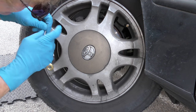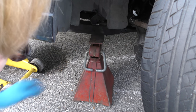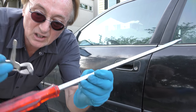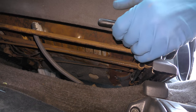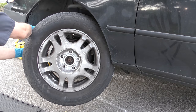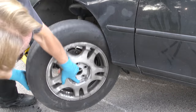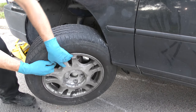I'll get a little screwdriver and we'll pop this cover off and take off the lug nuts. But before we do, let's put a jack stand — we've got to jack it up a little higher, safety first. Here's an old trick if you work by yourself like me: get a long screwdriver, start the car, jam it on the brake pedal, and we'll pull it forward to lock the wheel so we can take it off. The last one's going to be a stinker because it's kind of wedged in — I can barely do it by hand. We're going to have to turn the wheel some. A little more wiggling — there we go finally.